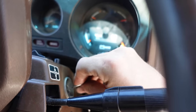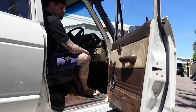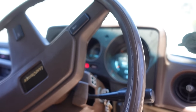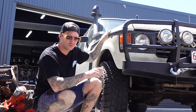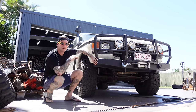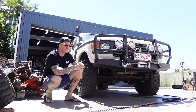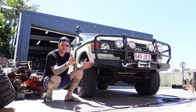Time for the finishing touches on the 60 series. That dodgy battery I put in — as I mentioned last episode with the dual battery VSR, I wondered if I could jump my own car off the auxiliary battery. It bloody works — watch this, I'll press this button. There she goes. So we've just finished off TJ's tub rack, now we're moving back into the 60. A few things to finish: putting the fridge in the back, finishing off the wiring. My power box still hasn't arrived, but luckily it's an Anderson plug fridge so we can just plug it straight in running off that second battery.